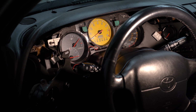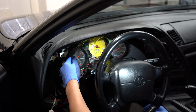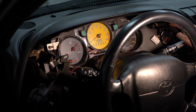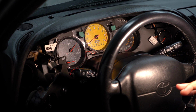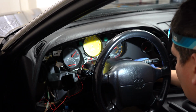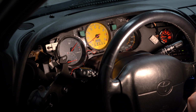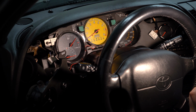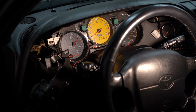So I know that before you put the key in, the needle stays at 0 and then you start the car. So what I did is I took apart the little clear protector part, and I was able to get to it pretty easy by just removing the 5-screw panel on the top and then removing a screw off the right one and then removing a screw off of the left one here. And I just kind of let that hang. And I navigated the clear part out, and then I just removed the needle, and then I put the key on. With the key on and the needle removed, I was able to just put the needle on it, and then I turned the car on, and at that point in time, it idled at 800 RPMs, where I know my car idles at. And so I knew it was good to go.